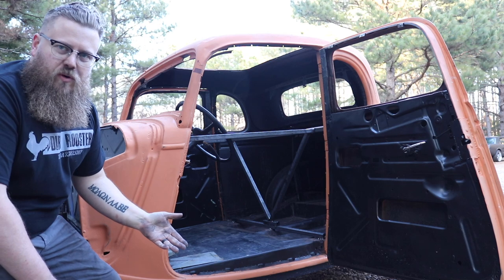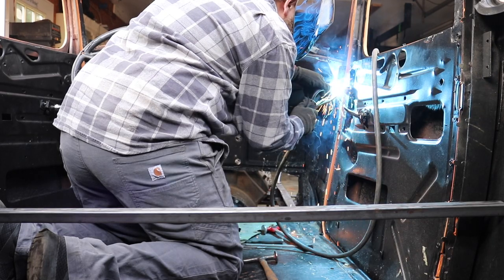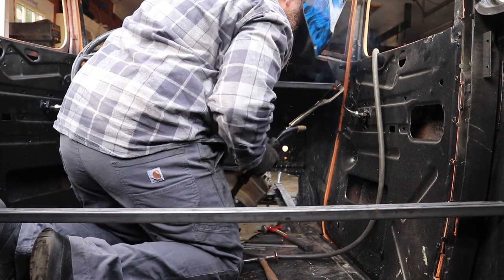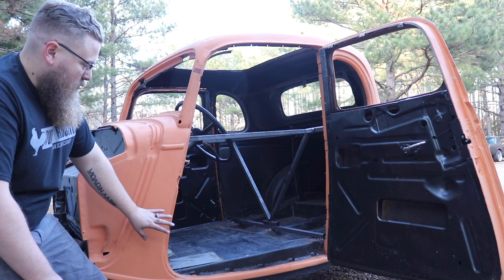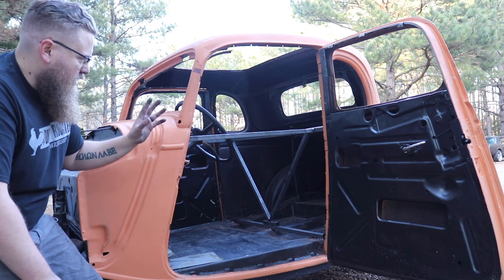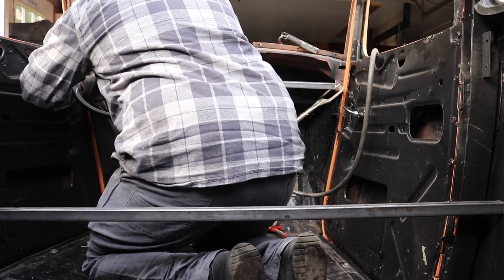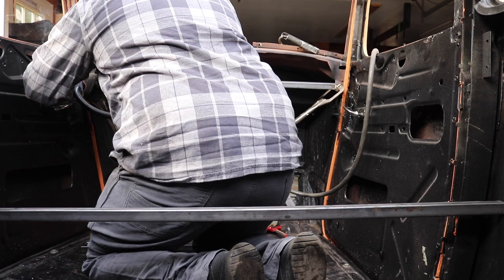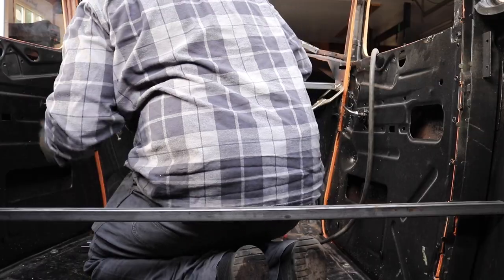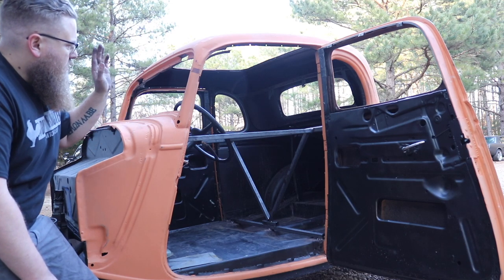Something really important in all my chops: I like to weld all the structure inside the cab with the door shut. The very first thing you need to do before you even think about chopping a top is making sure the door gaps are good — doors shut — and that the body is pretty close to being fully restored steel-wise. No big holes in the floor, no big rust holes in the bottom of the door. Stuff like that will come back to bite you when you're trying to square things up later. To get a really good chop, it's better to start with a rust-free cab.